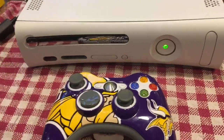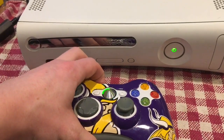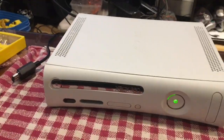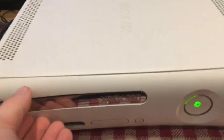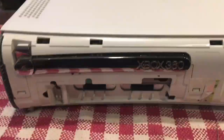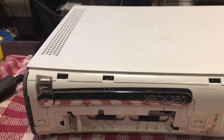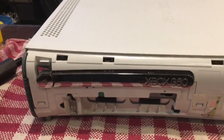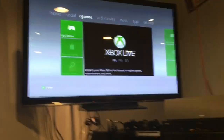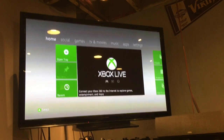It turns out it's been so long since I've synced up a controller that I forgot which button to use — it's the one at the top. The controller does sync up successfully. When I hit the open tray button, I'm not getting anything; the motor is just spinning. I'm suspecting there's a broken elastic band inside that helps get the drive tray to open. We'll open that up and clean it or replace the band. Otherwise the system appears to work generally — I just can't test disc reading without an open tray, so that'll be for the next video.